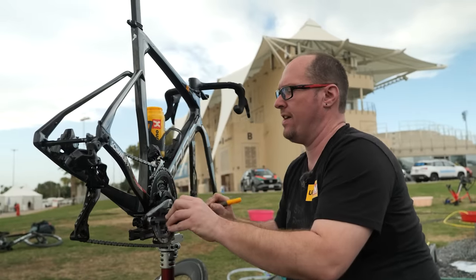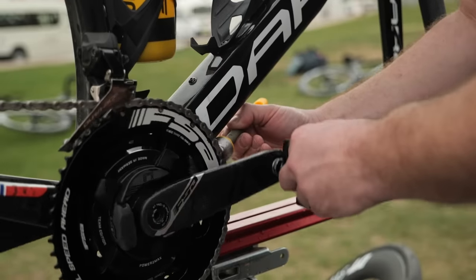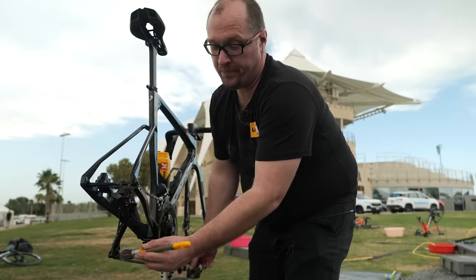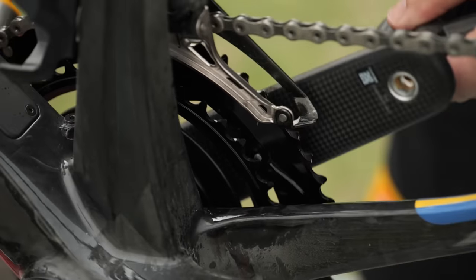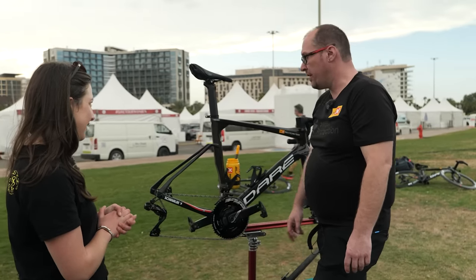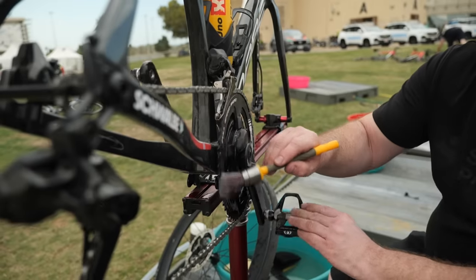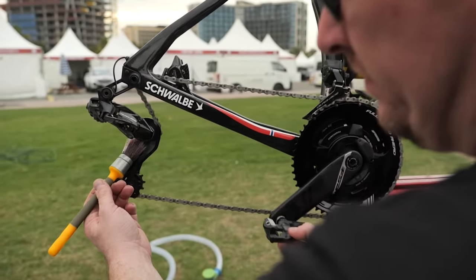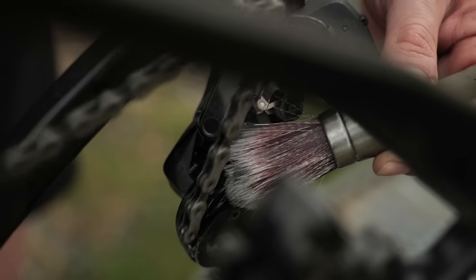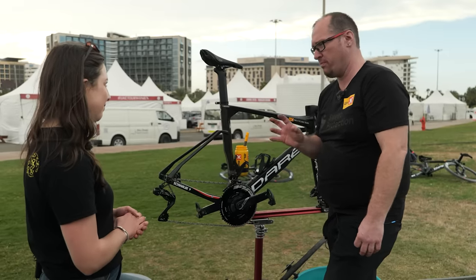The reason we're doing this is to really get rid of any road grime, any road dirt, any mud. For someone at home, it's super important because this is the bit that gets touched the least, and it's really important to get these as clean as possible for the best possible shift. What bit of the bike do you think people don't concentrate on washing the most? People are pretty good with the chain because there's all sorts of chain tools you can clamp on. But the bits that really get missed are the chain rings and the jockey wheels — especially the jockey wheels. I've seen jockey wheels on sportive riders' bikes with a massive build-up of mud and grime, needing a flat-head screwdriver to chisel it all off. That's super important because it's what helps the jockey wheels and chain run properly for a good shift.